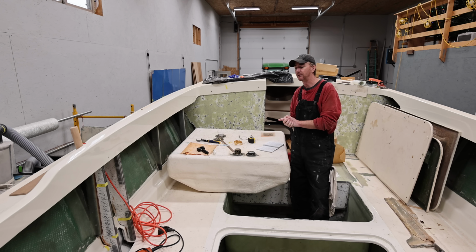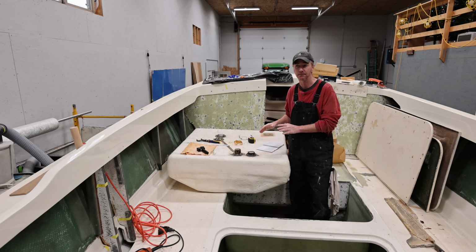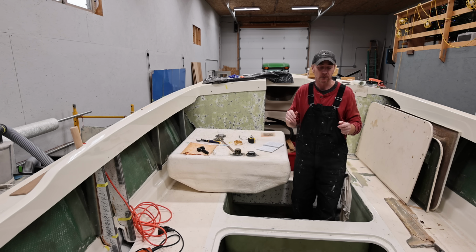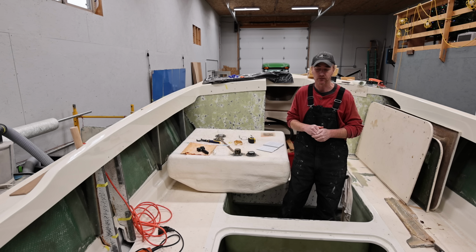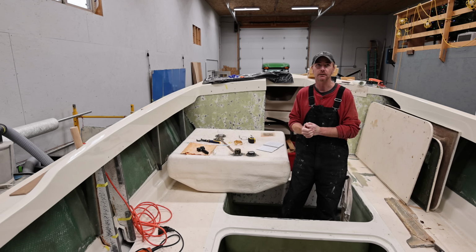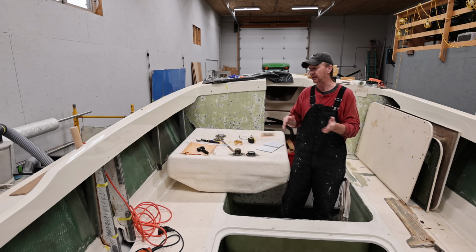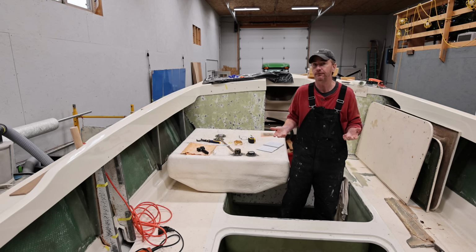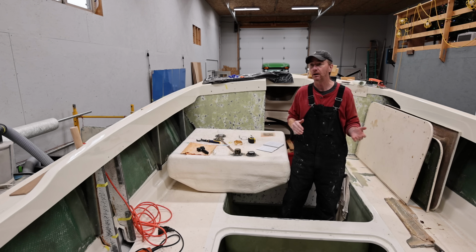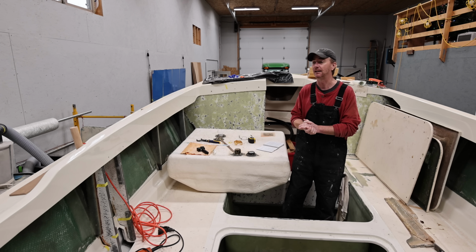The other thing to consider is that if I were to go with an aluminum tank, I could increase the capacity. They addressed one of the concerns that came up already, that 80 gallons is a little bit small. Well, let's work this one backwards here. Just to keep numbers simple, let's say this tank weighs around 300 pounds. Now, fuel or gasoline weighs roughly 6 pounds per gallon. So for that weight difference between an aluminum tank and this one, I could gain an extra 30, 40-ish gallons of fuel without adding any additional weight to the overall picture. So that's also something to keep in mind.